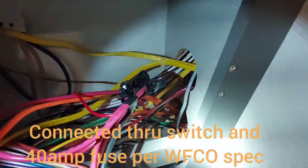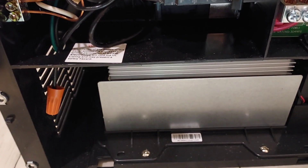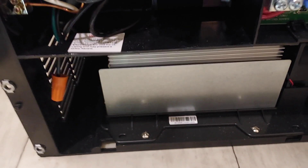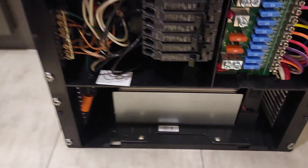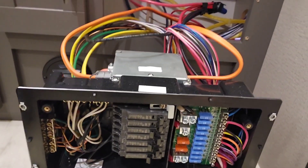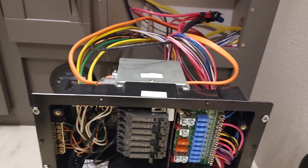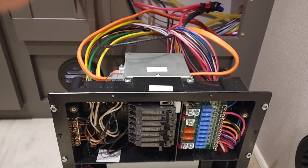There's another wire that goes to the battery switch — it goes out this hole and that's the one I'm going to disconnect and hook directly to the battery, so it's only a four-foot run. What they're telling me is my converter is going back to lead acid mode, and with this latest firmware it should work. They sent me an email with things to check, and one of them is the distance to your battery — they recommend less than 10 feet. I added up everything because I hooked my lithium directly to where the old battery ran, and I've got close to 20 feet of wire run, so we're going to shorten that way up.